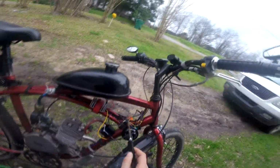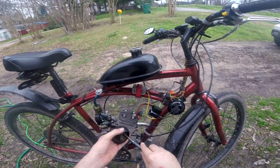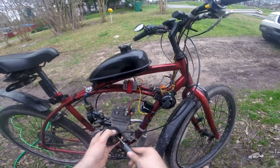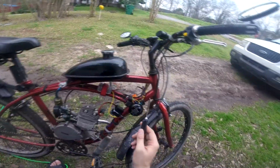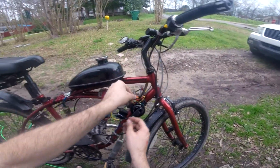Sometimes when you solder, usually after you've had to keep the heat on longer than you wanted to get something to solder together, you'll get these little sharp bits. From what I understand, that happens as the flux begins to evaporate out of the solder. Most solder you buy like this has rosin core. It's got a little tiny bit of flux that runs down the middle of it. The flux is what helps things solder together really easily. But it has a boiling point, which means that it evaporates pretty quick.